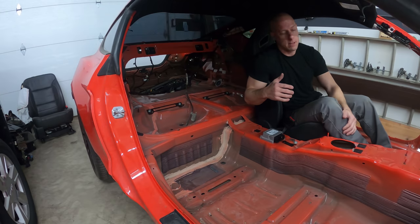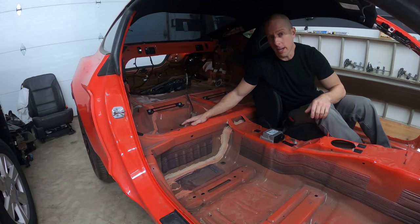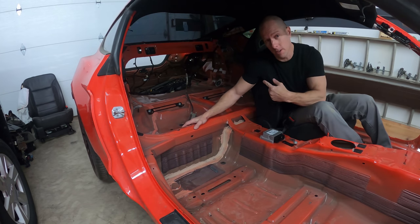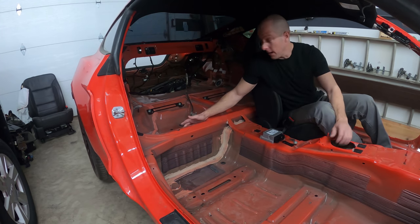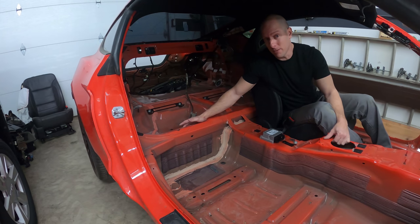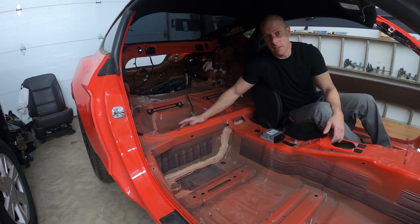So we've got our frame rails, our firewall, our trans tunnel — let's just keep going. We get to the back seat, we can now move our gas tank up here. The '65 has a gas tank that is the trunk floor, and it's not really safe. If I can use the gas tank back here, I can actually even use the original fuel lines from the 2015. If I can get back to the middle of the trunk, I can now use my independent rear suspension, which means I don't even have to make brake lines. It'll upgrade our weak solid axle in our 1965 and allow us to keep our anti-lock brakes and everything else without any hassle. It'll keep our suspension and maybe even our wheels and tires.